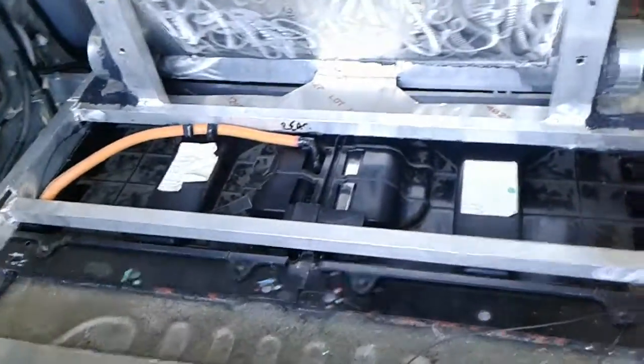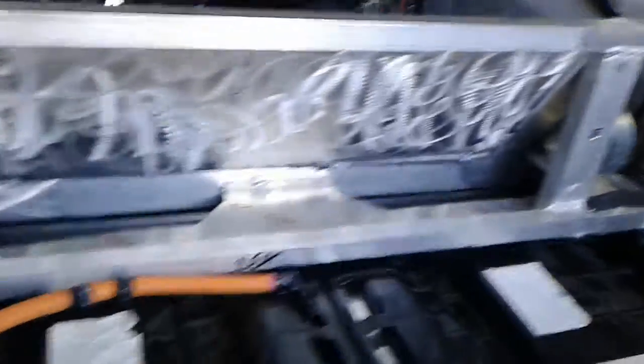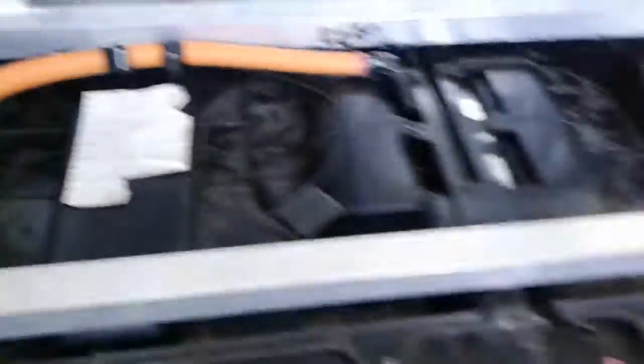This is the chassis for the battery box. There's the lower battery down there — it's about 150 volts. The way we've designed this is there's gonna be fans down there that pump outside air in through the ductwork, which those holes there actually go down into the lower battery box, and then they come out right here, which is gonna fill this chamber with the main box sitting on top with air.